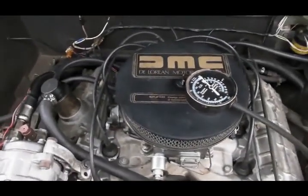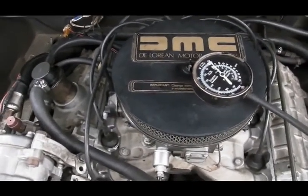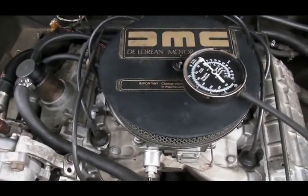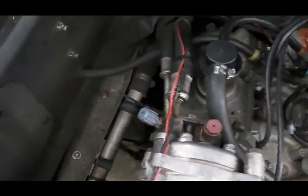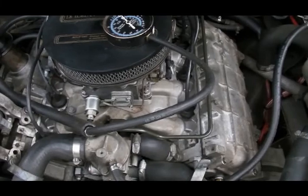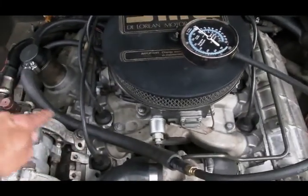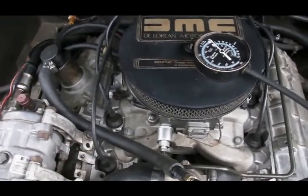So, if you're having PCV problems, part of your diagnosis is going to be to ensure that your engine does not have any other places for PCV to pull air other than the breather hose. This is the only place you want air to go into your PCV system.